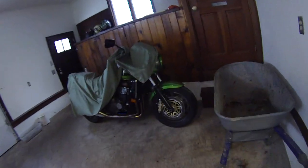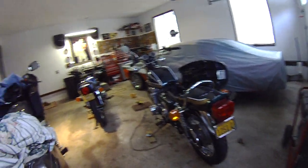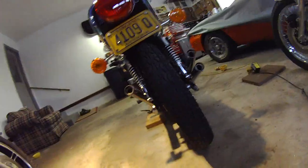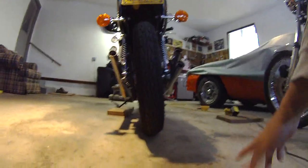The other thing that I do, that I get into in the article that you'll hopefully be reading by now, is to walk each one of these bikes around the garage and reposition them, and I do that every couple of weeks, and the reason I do that is to avoid flat spotting any of the tires, and I also check the pressure on the tires. The reason that that's important to do, bike tires for whatever reason tend to leak air more so than modern automotive tires do.